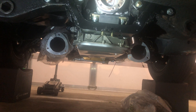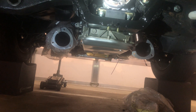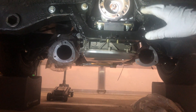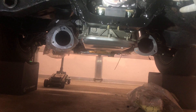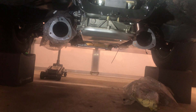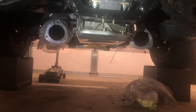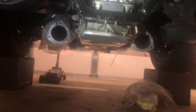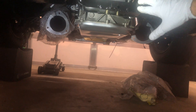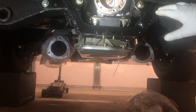What I ended up doing was using the crossmember to locate the motor forward to back, because I figured if they've done these before with Gen 3 Hemis and Hellcats, they know that forward-to-back position is good for clearing the water manifold at the top. So I kept the crossmember for that fore-aft location.